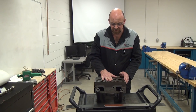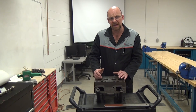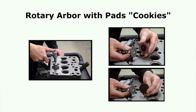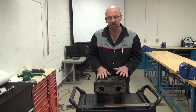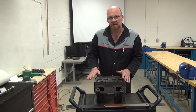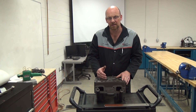Typical things done in the industry: people tend to use a 3M roll lock pad, sometimes noted as a cookie on a rotary arbor. They clean all over the deck, and because it's such a small device, it tends to cause more distortion in the deck surface. So the technician has cleaned it with a cookie or roll lock pad and has actually made more distortion — and you'll be able to see that when it's checked and inspected with a straight edge and feeler gauges.